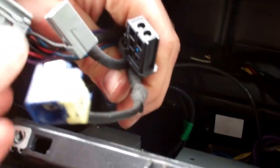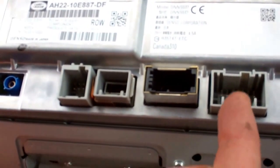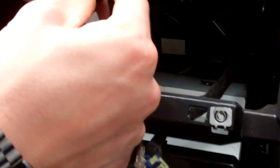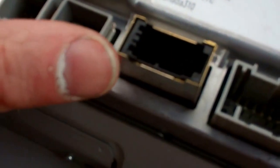So these are the connections we've got out the back and they've got these little push levers. That one was a push lever on the bottom of the unit, on the underside here. This black one is on one end and that's got a little squeezy side — that's the fiber optic bus, if I'm not mistaken. Next one over is again just on the bottom — another squeeze. That should be your reverse camera, we think. And then this is what they call a FAKRA connector.